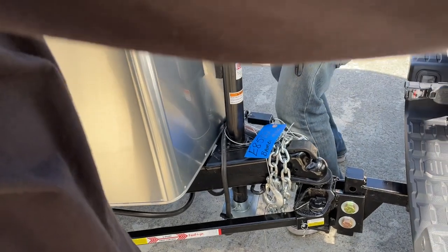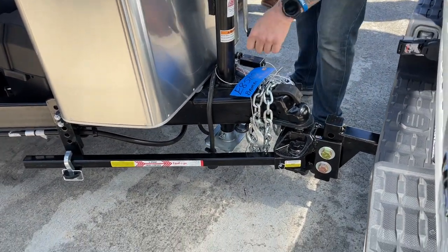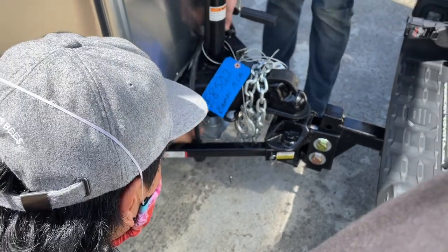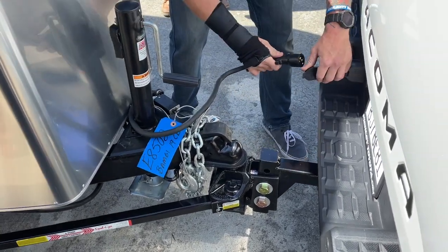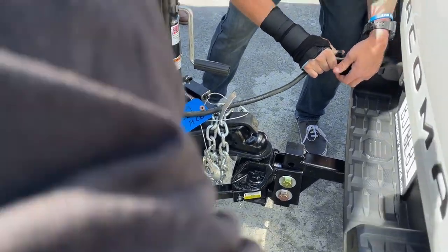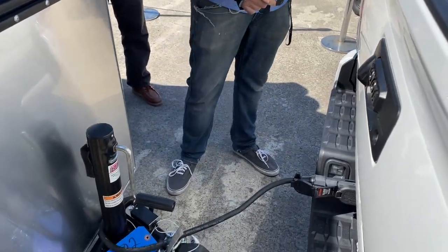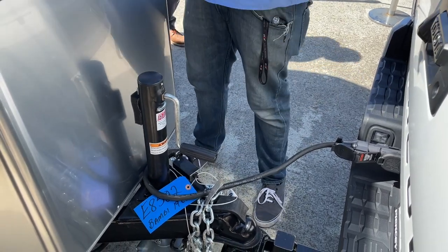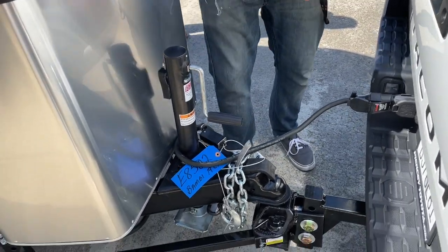Just a little extra knowledge: you don't really need to take off the foot — see how high you are. The foot does come off if needed — there's a little pin. Wrap this around here. This is your seven-way plug connection — this is what's going to top off the batteries while you're driving. For your backup camera to work, you need to turn on your clearance lights and headlights — that powers the backup camera. Turn on the headlights and you'll see all the trailer lights light up as well.